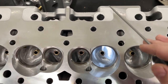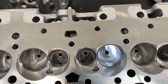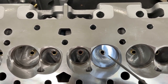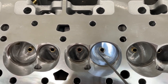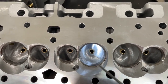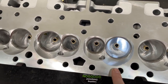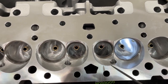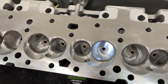The head itself is coming in at about 240 cc's, which sounds really large, and it is — it's a little bigger than what I normally do because this guy is turning more RPM. As far as sizing, the throat is 91% and the bowl is a little bit smaller than what I'd use on a Dragon Slayer. These do have 65 cc chambers, which I like. The exhaust port is way different from what AFR normally does — I'll show you that in a minute.